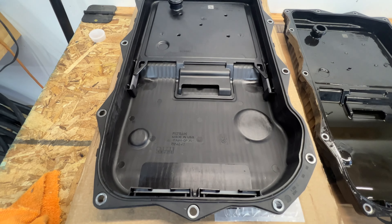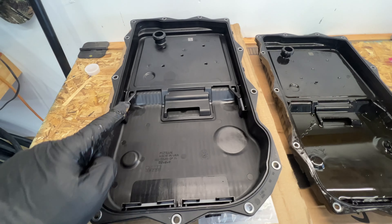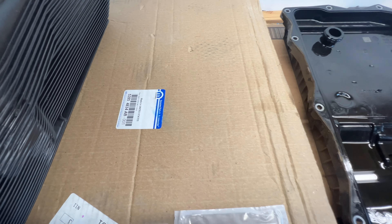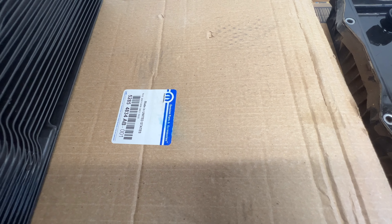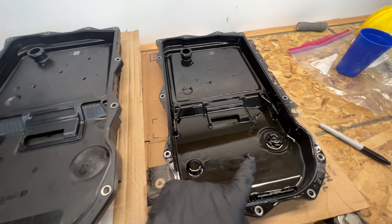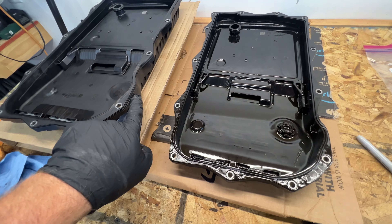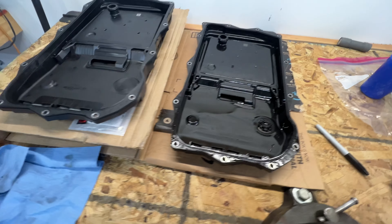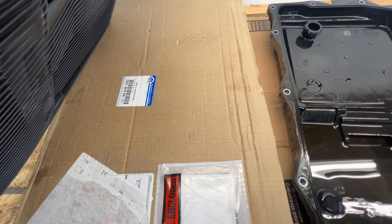This is going to be the new one. You can see our magnets there, and then of course our filter, with a new O-ring on there, along with the gasket. The part number for this is 5285-434AB. Now this is a different part number than what the old one is — the only difference is the last letter, so it's AA versus AB. This one does not have a drain plug, so I'm wondering if they just updated and got rid of it. But everything else on this matches up and it's exactly the same. I did get this off eBay — that was the cheapest I found it, and I'll put a link in the description.